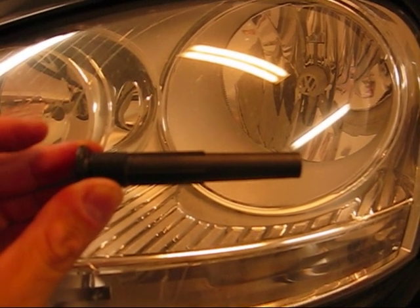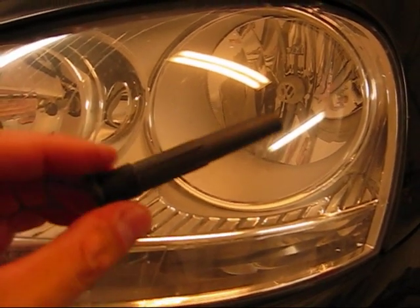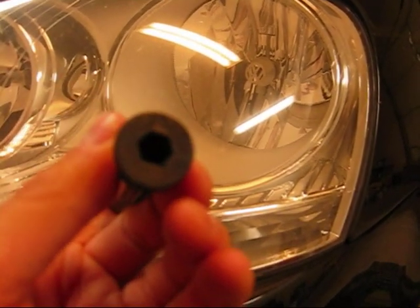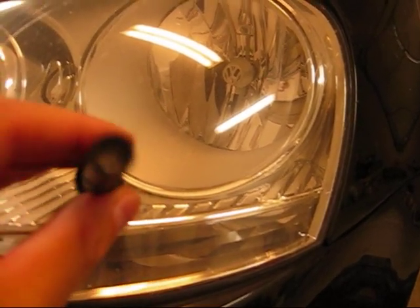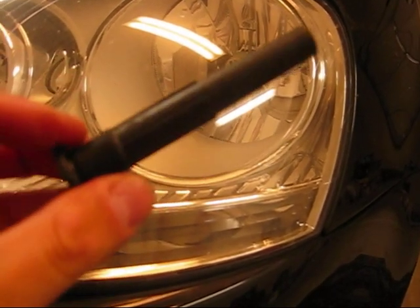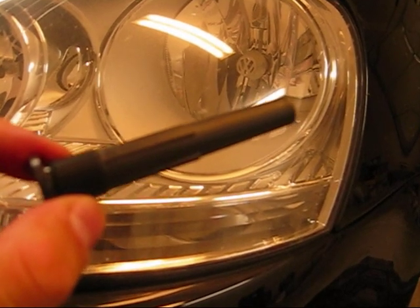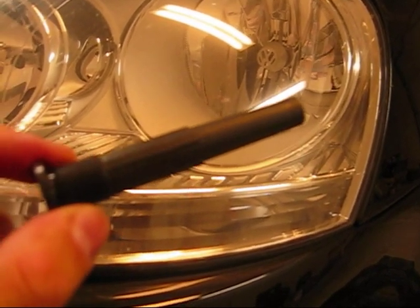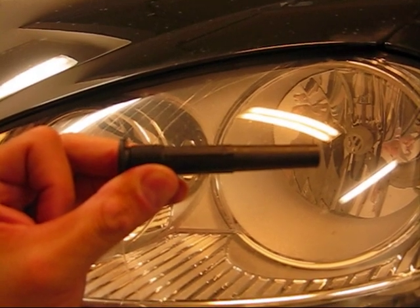This is the overflow tube. Make sure it's absolutely clean before you reinstall it — I sprayed it with some MAF sensor cleaner because it's very friendly to plastics yet does a very good job at cleaning. It's threaded with that 8 millimeter Allen key slot right there. This only requires 3 Newton meters, or 27 inch pounds, or 2.25 foot pounds — be very careful. It's practically hand tight. If you break this, you're not driving anywhere. Should you break it, the part number is 02E321363B.